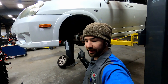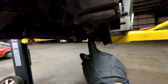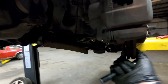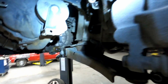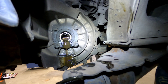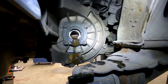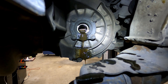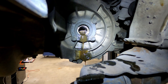Now we're on the driver's side and I've already got the driver's side CV axle out using the same routine. Just pull the 14 millimeter bolt that holds in the lower control arm mount and use the pry bar to pry the control arm down. It allows the assembly to swing enough out of the way that you can push the CV axle through the knuckle and then get it out from the transmission. On this side, when you pull it out from the transmission you are going to lose transmission fluid. So I'm going to go ahead and replace the transmission fluid — drain it all out and put fresh fluid in, because you can see it's kind of brown and nasty. It's probably a good idea to do it if you haven't done your transmission fluid recently.